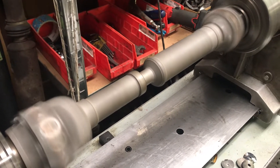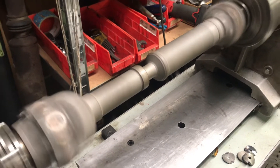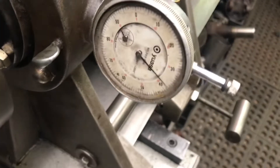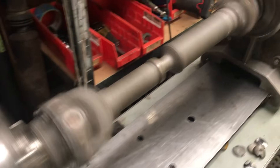So we're cranking it up here. This is a very good result — this shaft was good. I did make a minor weight correction back here, but zero at the rear axle. That's about 2,700 RPM. Zero at the transfer case as well. It's got a little flutter, but there's nothing there. This is a very short shaft.